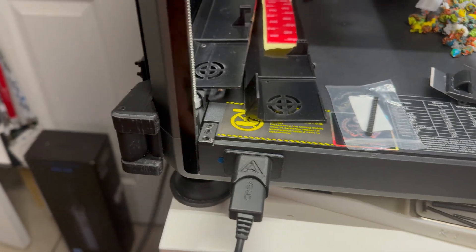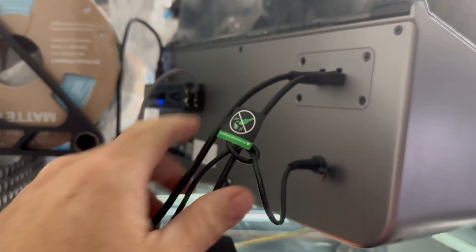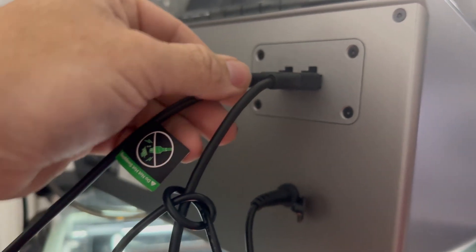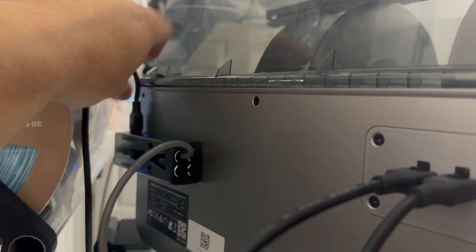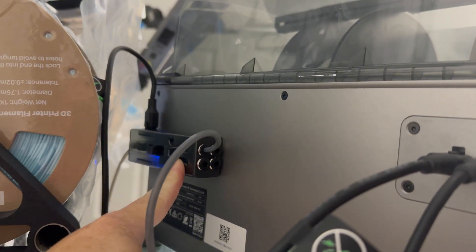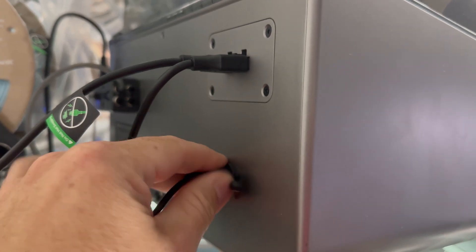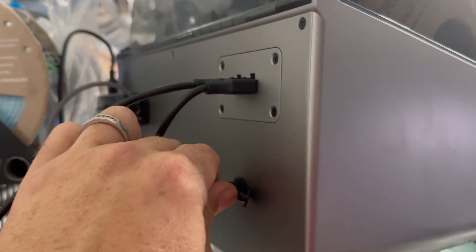Now it's time to connect your CFS at the USB port and hook it up in the back. Over here on the back of the CFS, here are the connections you need to make. Coming from the front of the machine, you'll have this long cable running to the front of the machine, plugged in here. Then you have another little six-prong cable that's going to plug into your buffer at the top — you can mount your buffer wherever you want; I chose to mount mine on the back of the CFS. You also need a power cable going into the CFS itself — I've got mine tied down so it doesn't come out. Run yours however you want.